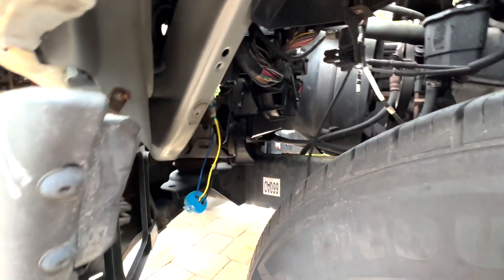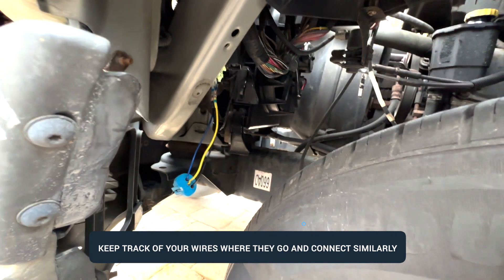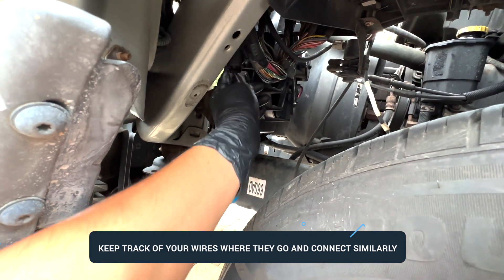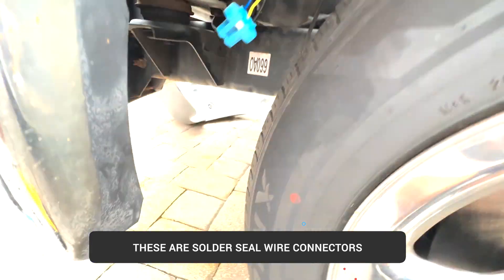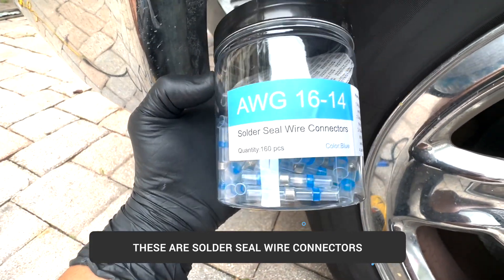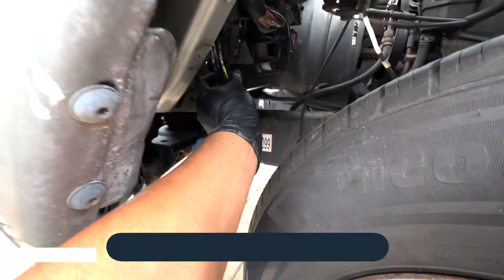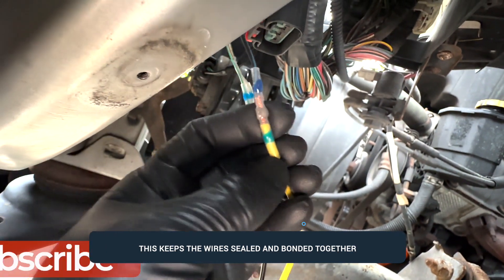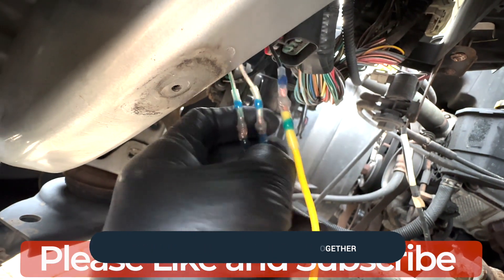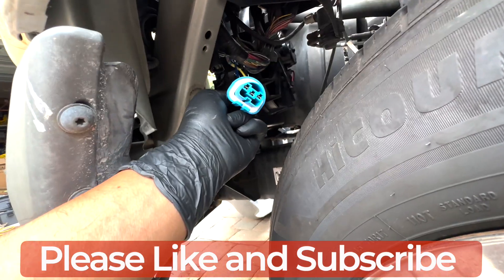The tricky part is how to connect it. What I did was clip the endpoints right there - cut it very close, as close as possible, because you want a lot of wire. There is normally a jacket on it which you can peel off. These are splice connectors - AWG 16/14. The way you put them on: twist the two wires together, slide it on, and heat it. There's a metal piece inside which melts onto the copper giving it a solid connection, then it seals so you don't have any moisture issues. Do all three connectors and you're ready to put that light back on.